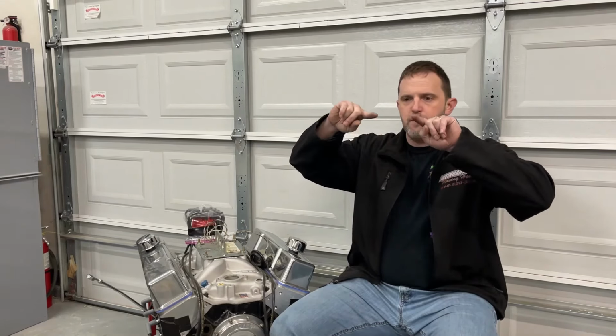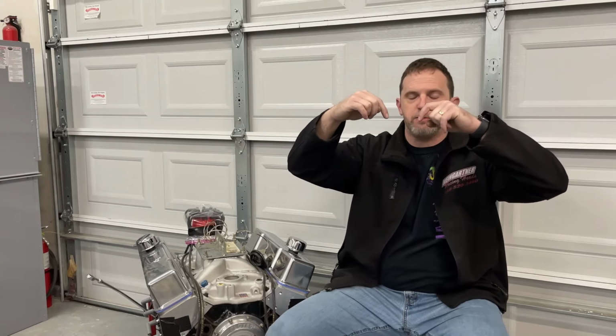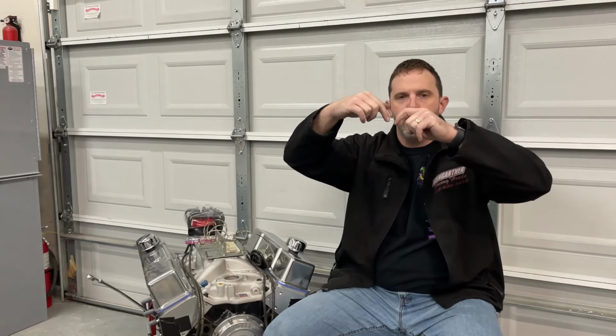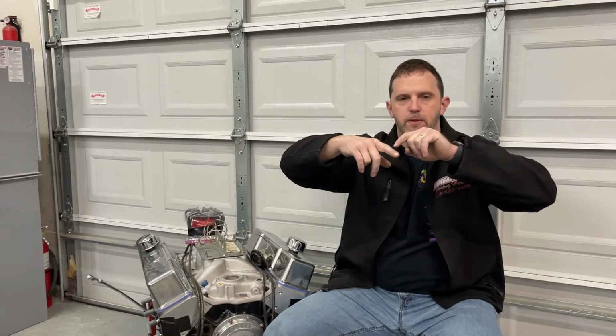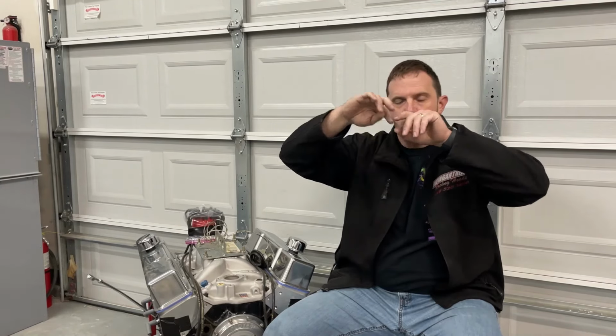It tapers this way. Well, what had happened was, whenever they put it in and they used a bolt or whatever, evidently part of where it was tapered, part of that metal at the very top, broke off. I've seen this in caps before, luckily I just haven't had it. So the threads were still holding it, but the taper part, the thread part of that metal there had broke off and it got shoved into the pump in some way, and I'm not sure how that happened, but somehow it went to the pump and locked it up.